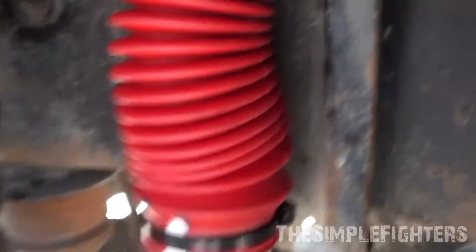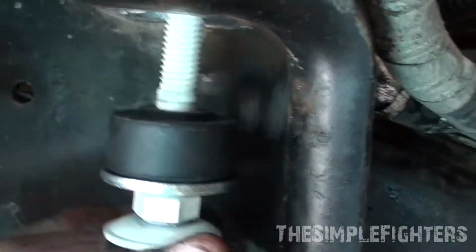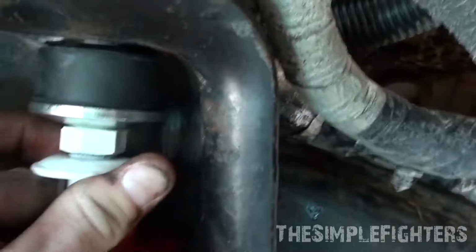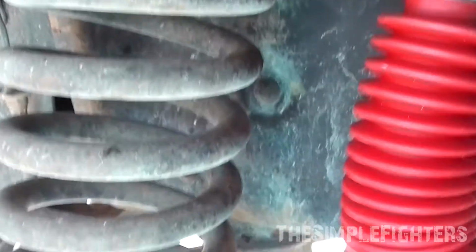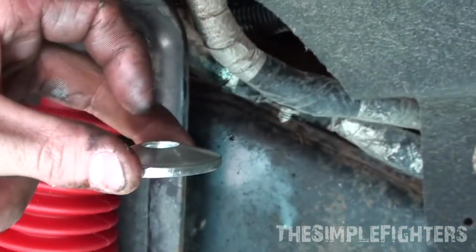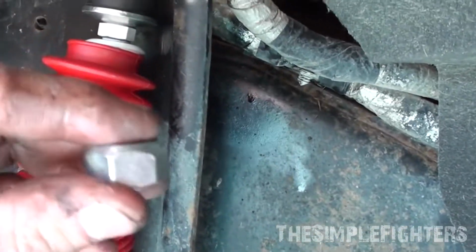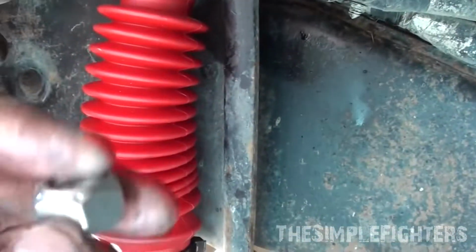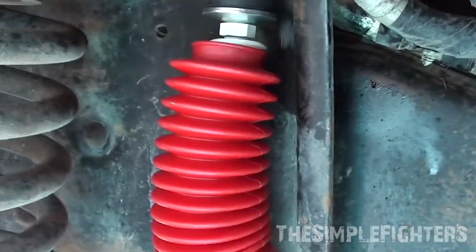Okay, now for this, again, washer down, grommet, and you will pull this up. That bolt's gonna come out there, black dots. Washer cup is now down. New nut. Obviously have the flat side down. So, make sure the flat side is down. Same way to tighten it up.